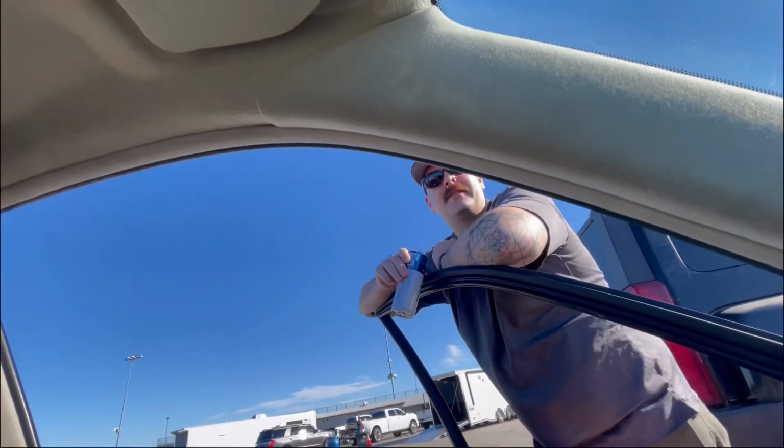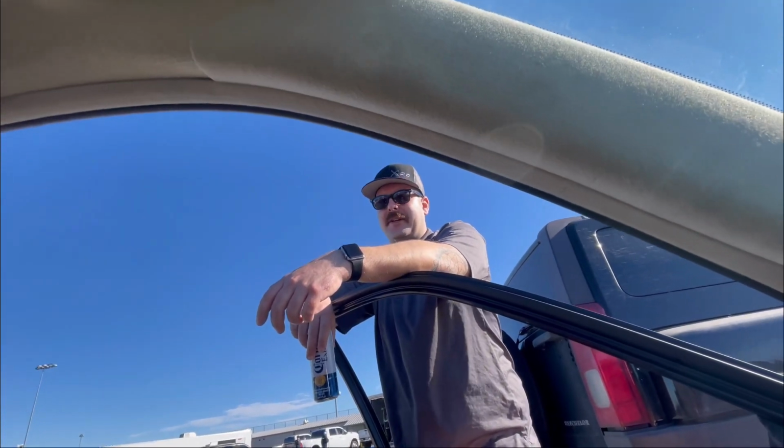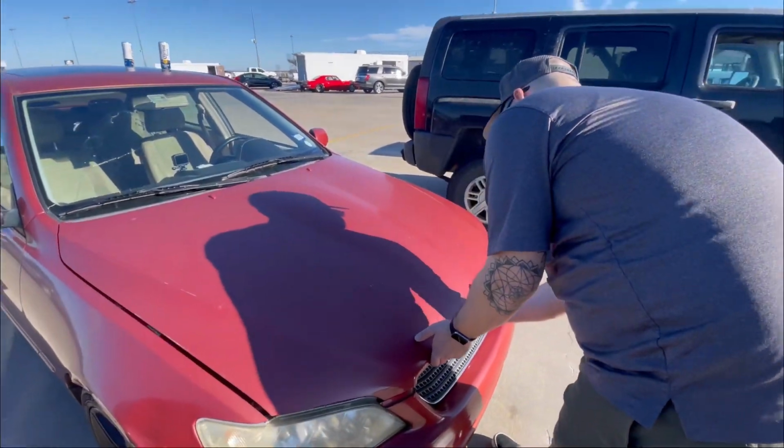I think we'll be in pretty good position to be just in third gear. And I do think we should probably pull a pound out of it. I think so for sure. I bet you the nitrous bottle pressure's gone up just sitting in the sun in the trunk. Yeah, I'm sure it has. It's way warmer now than it was 2 hours ago. Okay, well, that's the plan. All right, let's see if we caught any coolant.